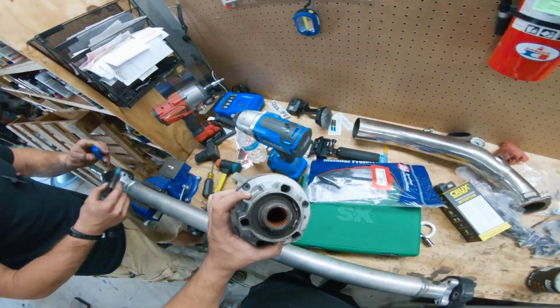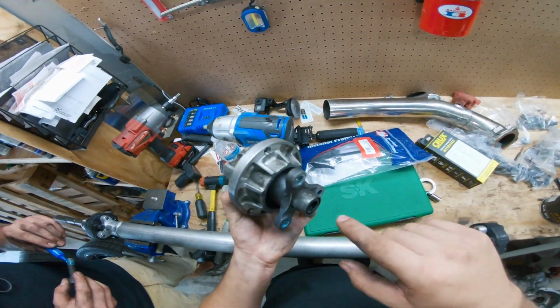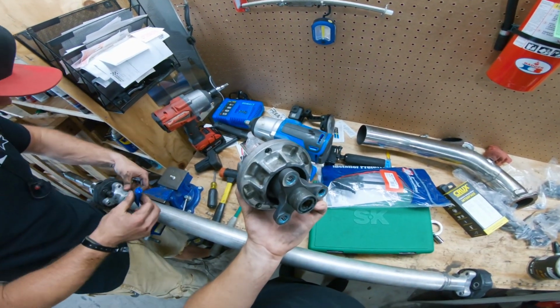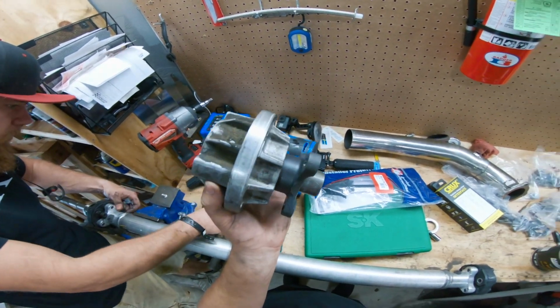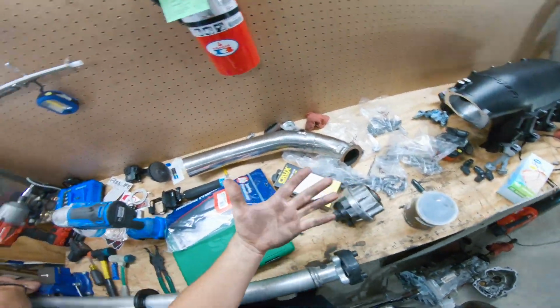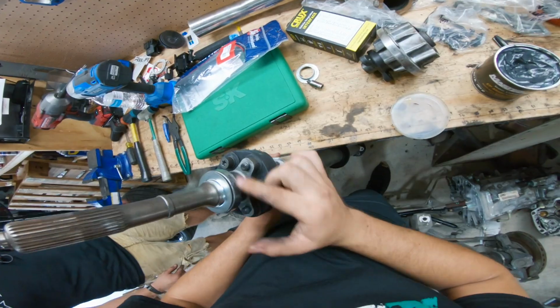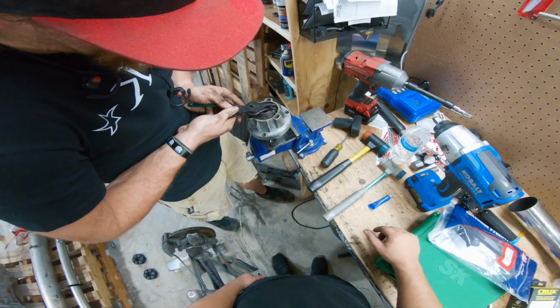It's just got 2 bearings inside of here. One is right here and one is back here. All we've got to do is take these various snap rings out, separate it, split it open, and replace that. And it would be good to assemble the entire torque tube again. Some grease all over this bearing race right here so it slides back onto the shaft real nice and simple.